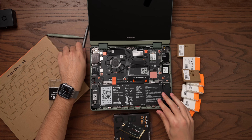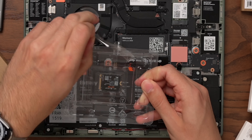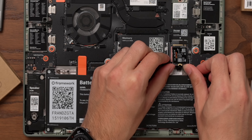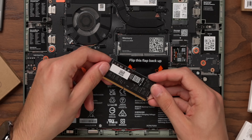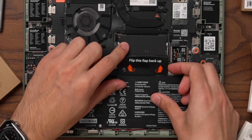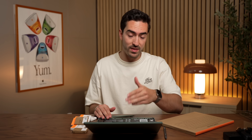It sure is fun to have a little DIY before you get to use your laptop. Look at that little tiny SSD — one terabyte does not take up as much space as it used to. There's a little pad underneath to make sure everything seats properly, and check out this no-screw SSD mounting system. It's just a little clip that pops it up and holds it down. RAM next — we've got 16 gigabytes of DDR5 single channel memory, and that is honestly the biggest drawback to this platform. Because it's so thin, we only have a single RAM slot, so you're only going to get single channel speeds, and it can only support up to 48 gigabytes in that single slot.